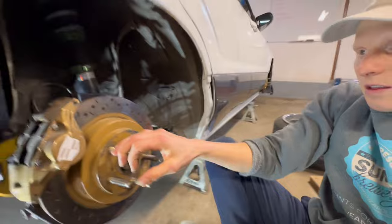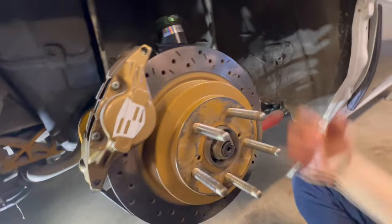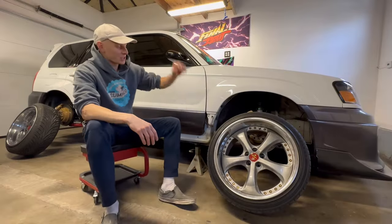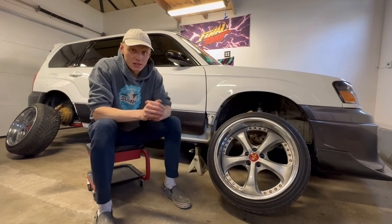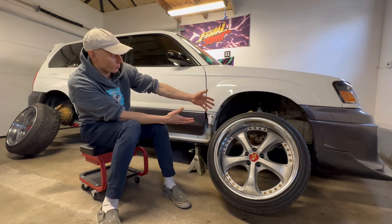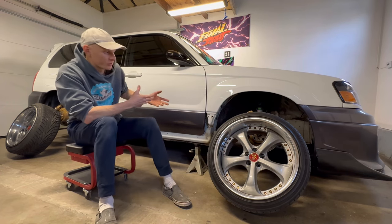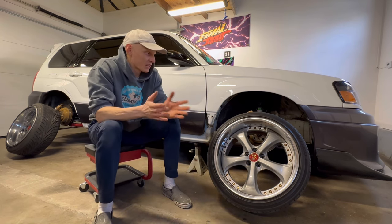On the exterior, I've upgraded the brakes just like in the front — this is a WRX Limited two-pot caliper, with DBA rotors back here, extended studs just like all around, and then of course the counterpart to the front coilovers: those Fortune 500s — with a little bit of damage from the inside of my wheel, apparently. Well, there you have it — that is my drivetrain and suspension components in a nutshell. I'm sure I've missed a few small things, but overall the major pieces are those big Brembo brakes, the coilovers, the six-speed transmission, Driveshaft Shop components, and all those reinforcements in the back that facilitate that power going to the rear wheels.